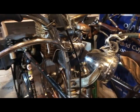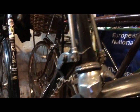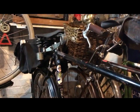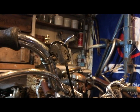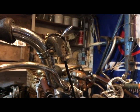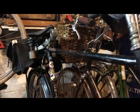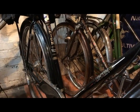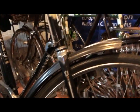The massive Union — you saw it on an early lockdown video as well. It needs the shifter looking at; the three-speed shifter — I think the cable might be unseated inside the shifter slightly — gives very vague gear changes and it's self-shifting sometimes. I shall take care of that. Apart from that, it's just a lovely lovely bike to ride.